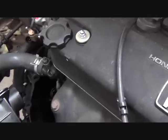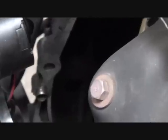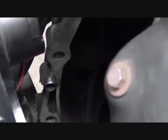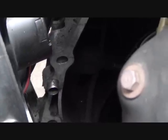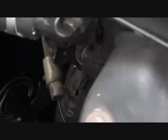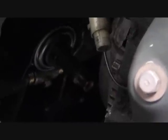Next, we're going to put the transaxle back into place, and there's these alignment dowels. There's one. There's a couple of those on either side, front and rear. And so we have to be careful to not damage the transmission input shaft or the friction disc splines. So we need to get this all leveled and lined up, and then slowly move the transaxle up against the engine block.